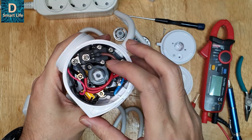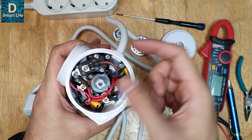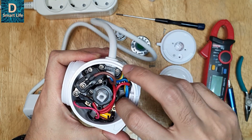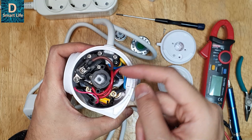This is looking quite good so far. This is the reset button; the power comes in here and goes through a switch that is controlled by water pressure, so it turns on only when the water pressure is on. There are earthing connections and circuitry for the temperature sensor, plus temperature sensing probes going into the heater.